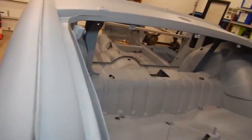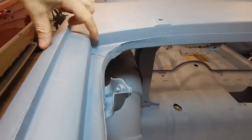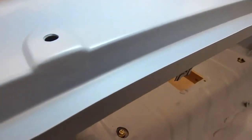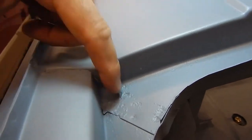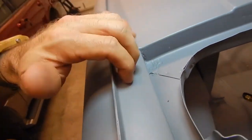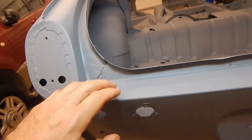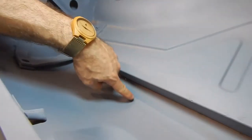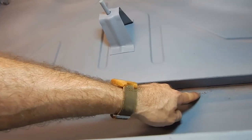We're kind of coming to the back of the car, so let's talk about the trunk. The channel up top — nice and clean. A little bit of pitting in this area where you're going to get water and leaves building up and moisture staying, but not rusted through — not bad. This piece: perfect. Even down here, this piece is nice and solid. I'm just pretty happy about the trunk floor. The main problem area is right here where water will collect and not want to drain — and sure enough, that's where we have some breakthrough.